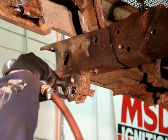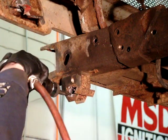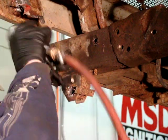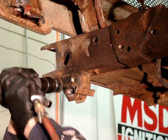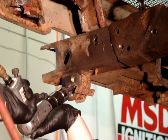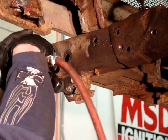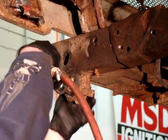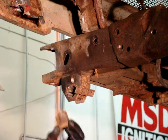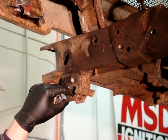We work our way around it, and out comes your bushing. So there it is — that's how you remove your steel bushing: work your way around and then pound it out. Then what we'll do to prep this is go inside and take all the little burrs off with a small rat tail file and smooth it down.